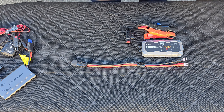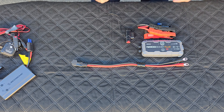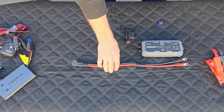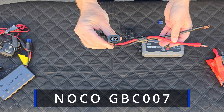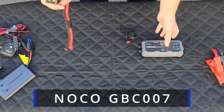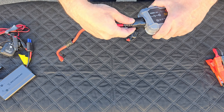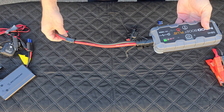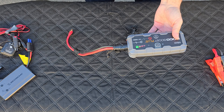Going forward, I wanted a system where I can attach it directly from the outside of the bike to the battery and jump-start it without needing to remove the battery tray. So this is the system I came up with. NOCO sells this adapter - you plug it into the battery permanently, and this end plugs directly into the booster. You just plug it in, turn the unit on, and you can jump-start it. I'm going to demonstrate this now.